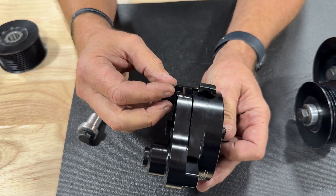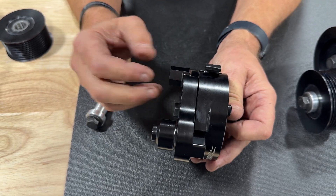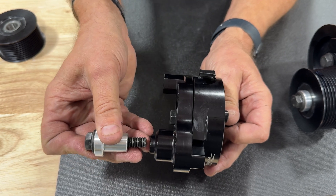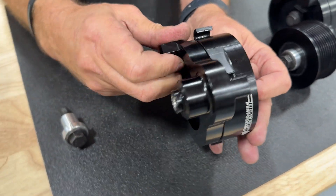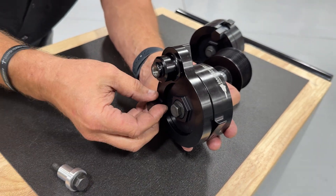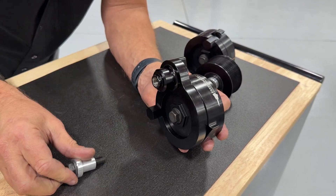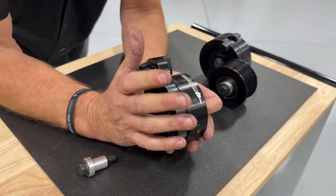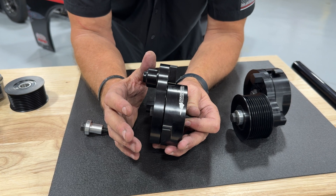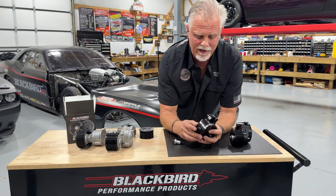We've also given you a point where you can put a 15mm or 17mm hex socket and torque the tensioner over using that location instead of the bolt — which you really shouldn't use. It's positioned in the car where you can get a nice extension and socket on it to install your belt. One of the secrets of this tensioner is that more spring force and more tension in the belt is good up to a certain point, but beyond that it's bad.